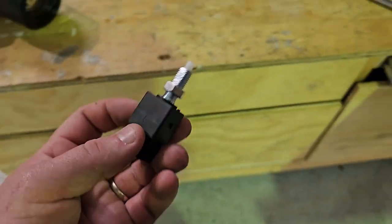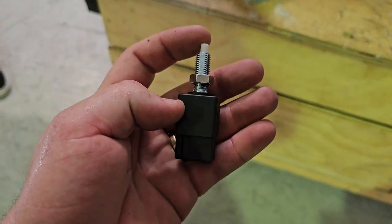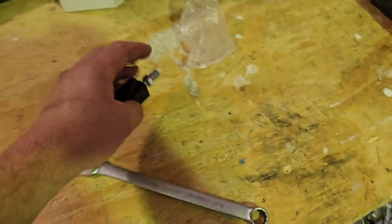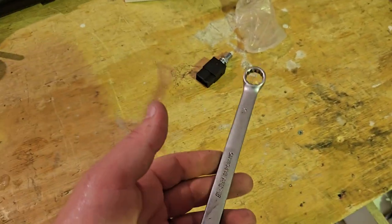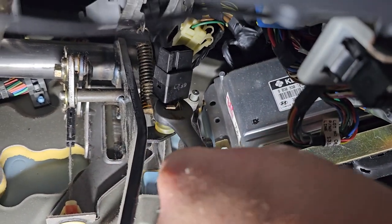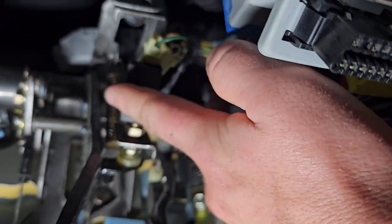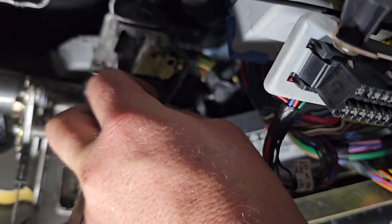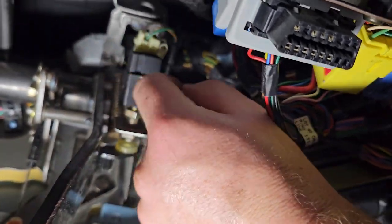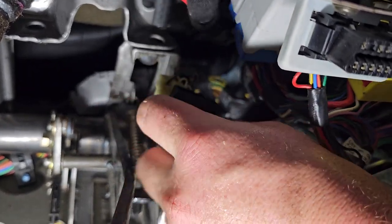Before we go any further, I just wanted to show you the PartsFactory equivalent here. As you can see, these are an OEM exact replica. So if it's something that you need, definitely cruise onto the website — the link will be in the description of this video. The spanner you're going to need appears to be a 15mm based on the PartsFactory one. I hopped under here with the 15mm and basically put it onto this section here and undid that. At that point, the whole switch just screws out — keep screwing and you will notice that it will fall off. And there it is.